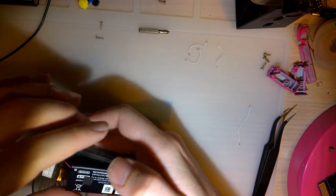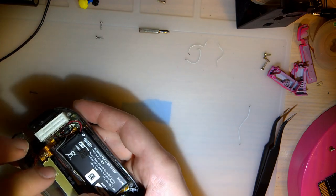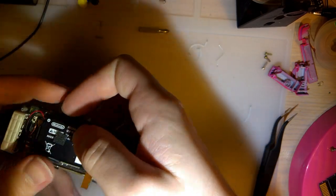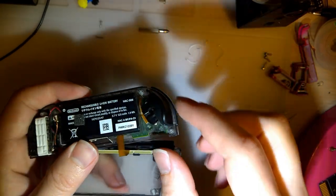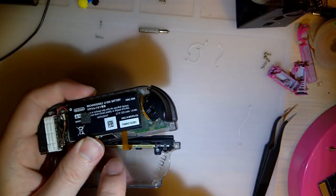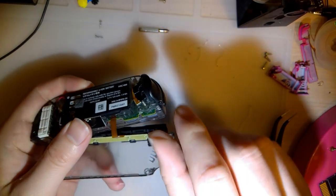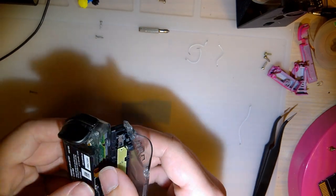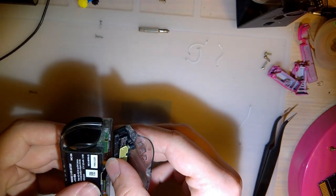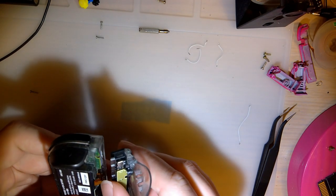And by the way, to get that battery out, I totally took a shortcut, and it worked excellently, so I'm going to share. Pop these two screws out for the shoulder button, and then you can slide this over a little bit, and then you can loosen that screw, and then you can flex the board and the casing enough to slip that out without having to take this whole darn thing apart. So I did that while the camera was cooling down, and I think we're good now.